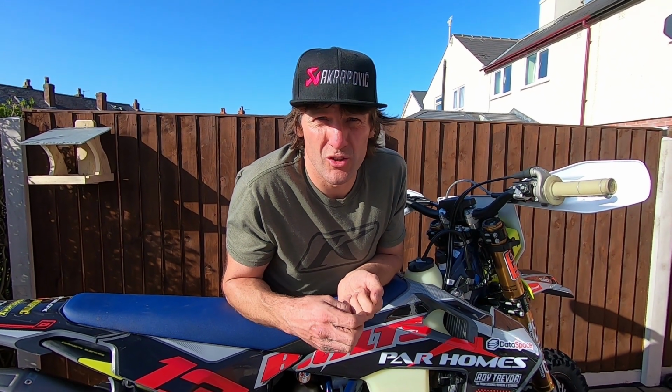But you can run lower pressures with the mousse, so you might have more traction, which could help in getting up a hill that your friend can't. But also, if you're just out with your friends at weekends, then tubes are going to be just fine, because you're just out there for the fun of it. And if you do get a puncture, you can either just ride back early or literally just fix it at the side of the track. So that's what I think about mousses versus tubes.